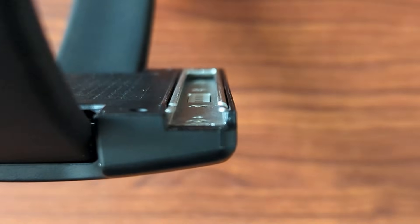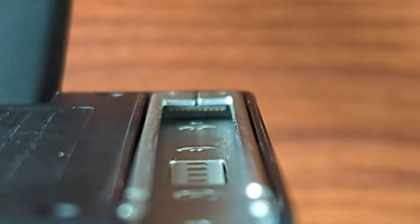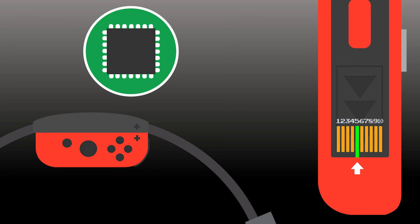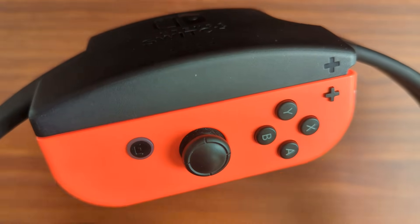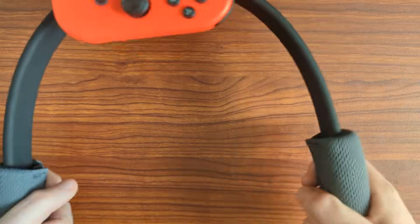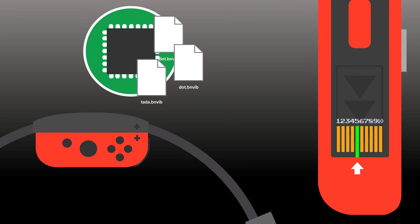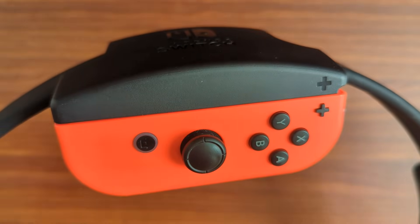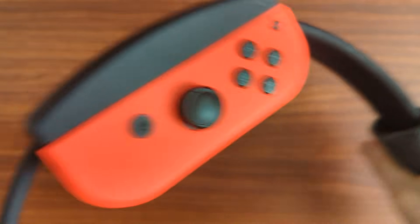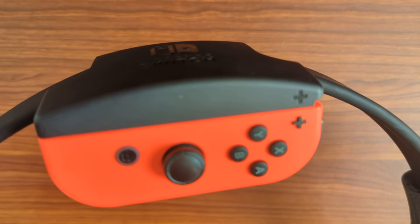When the Joy-Con is slid into the Ring Con, the pins touch receiving contacts, which form a connection. These are cleverly hidden and make it feel almost like magic. When activating Multitask Mode, Pin 9 sends power from the battery out to the Ring Con. On Pin 5, the Joy-Con receives information from the Ring Con on how to act. The Ring Con's firmware seems to have special instructions that control what LEDs should be active and contains its own binary vibration data. Sound is vibration, after all.